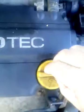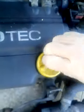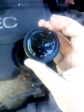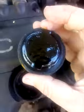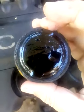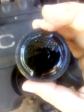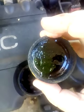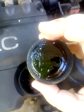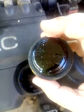In second place, you must do the same with the oil cap. You can see this one is now black, but if you see a yellow tone or a brown color, this indicates a leak between the cooling system and the oil system.